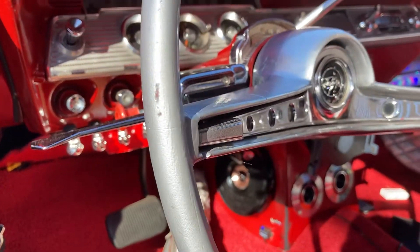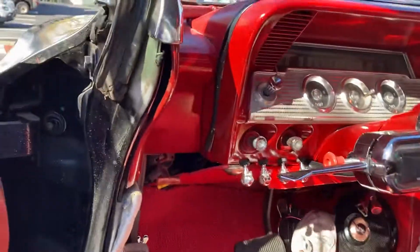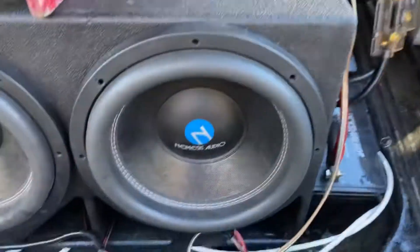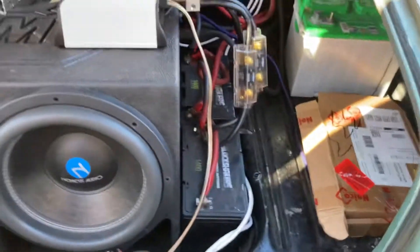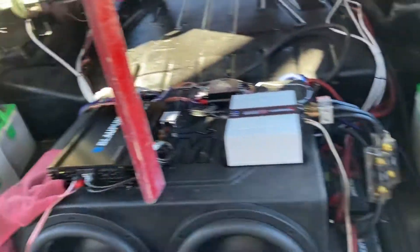It's a good alternator for my system. My car battery doesn't die. The reason I bought this alternator was for all my speakers. I've got two 12-inch subs and two audio batteries in the back. I've got two zero-gauge ground wires coming from the alternator itself, running two zero gauges back to my batteries and spreading out to all my amplifiers.